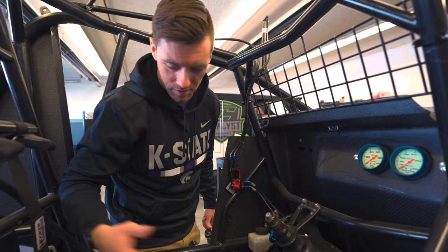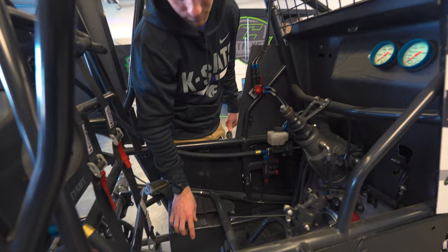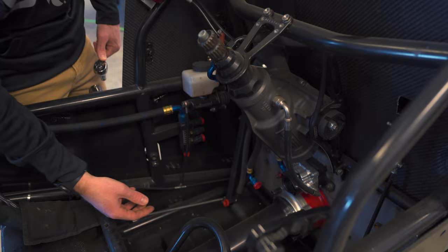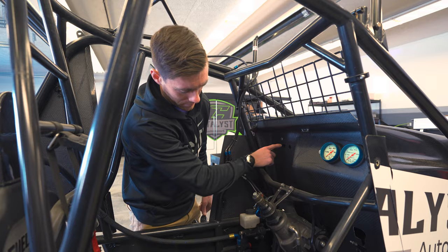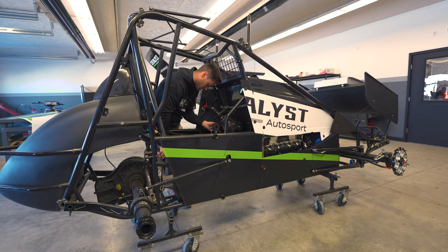So we could do a quick anatomy of the cockpit of a sprint car. The seat's not in here right now — it's actually in my iRacing simulator back in my apartment. When we get closer to race season we'll put the seat back in. We've got some safety blocks down here from GI Safety Solutions so that if I get in a crash and the rear end breaks loose, the torque tube here doesn't slide around and break my ankles. Power steering pump here, fuel pump will sit right on top of that. Brake, some fuel lines, shifter, throttle and brake pedal. Only two gauges — oil pressure and water temp. Tach is here but not in the car right now. Pretty tight once you get the seat and body panels on.